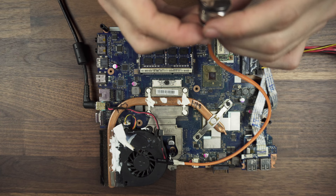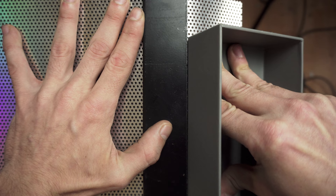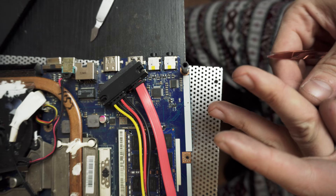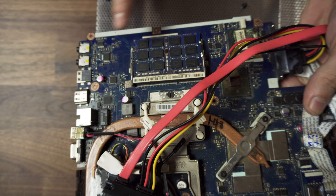Start by measuring your motherboard on a piece of perforated aluminum sheet. Trace a straight line on the marks — the lines will be your bending points. To bend, use the edge of a table and apply pressure while you keep it in place. Aluminum is very easy to work with; it will not need a lot of effort. You can use a sharp object to mark the holes, in which you insert a screw and a nut. This will raise the motherboard and prevent damage.